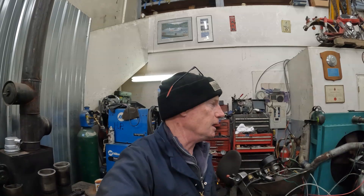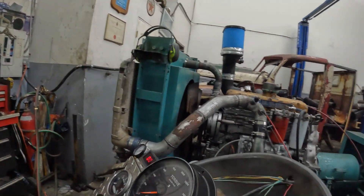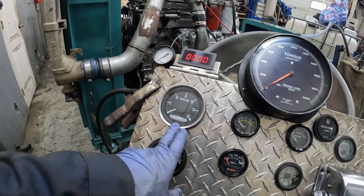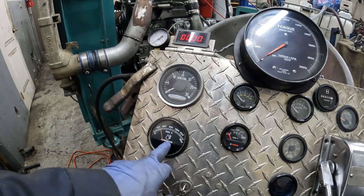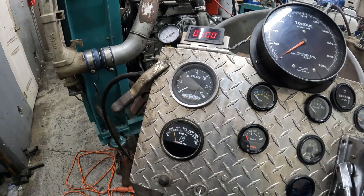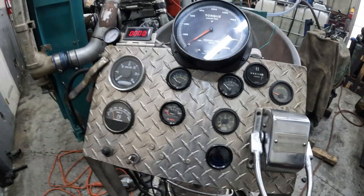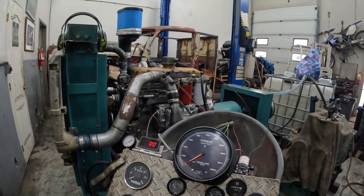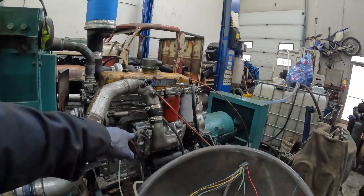We'll try different compressors in this thing — it runs really sweet. For the next dyno session we're going to repair the tach. That water meth was working pretty nicely; I didn't break 900 on the EGTs, and even 950 is fine for short periods — you're not sitting there at 950 forever. It really woke up with this last set of injectors and I'm really happy with those. The smoke really isn't that bad — I think I can clean that up with an end blower and a bypass perhaps.